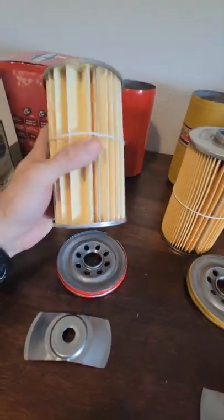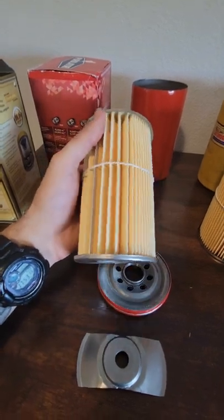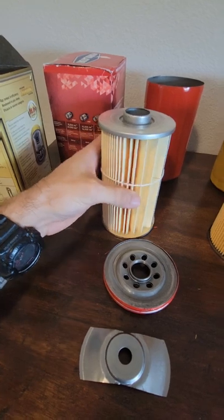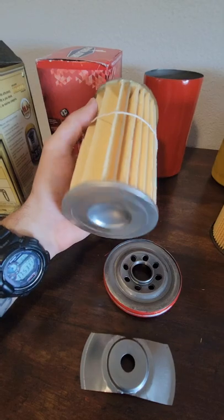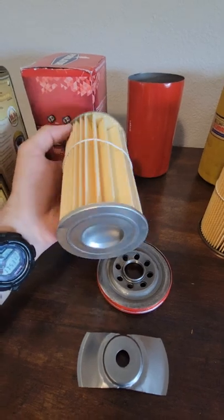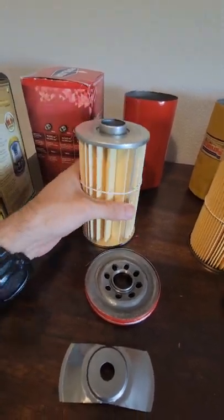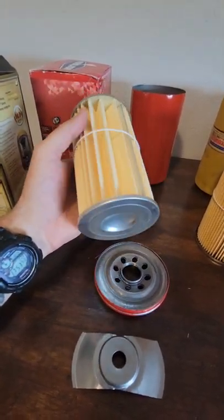Starting with the cheap one, you'll see immediately that the quality control is a little concerning — I have about a third of my filter with pleats all over the place. The pleat spacing is absolute garbage on this one. I don't know if this is how they standardly make it or if I just got a bad day, but that's concerning. I will say though, on all these — even the cheap one — the glue jobs on these filters are fantastic. Not all over the filter media, not bulging out. Good job on all the gluing from Purolator, even on this cheap filter with the bad spacing.